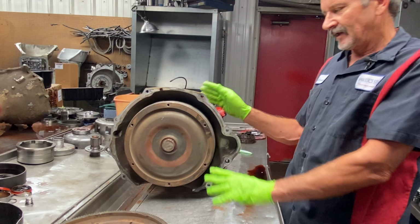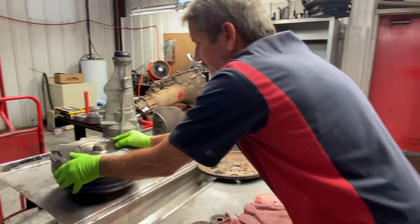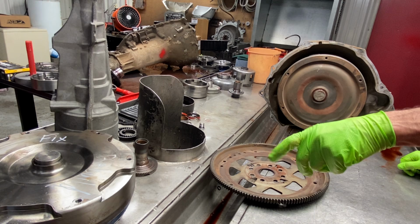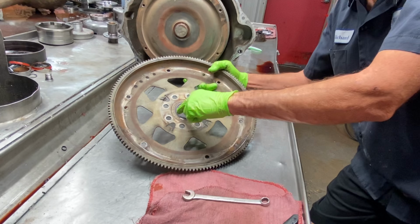Now we do have one that we just did that we just drained here. I'm going to try to move it. Now you can see the backing plate on it compared to this style. They make multiple styles. Now this, I believe, is a three clutch. This could be a single or it could be a three, depending on what they built it for. Now also, if you get in here and look, the center of this flywheel right here is worn plumb out. I mean, this thing is wobbly,